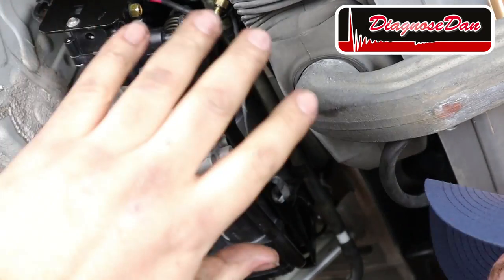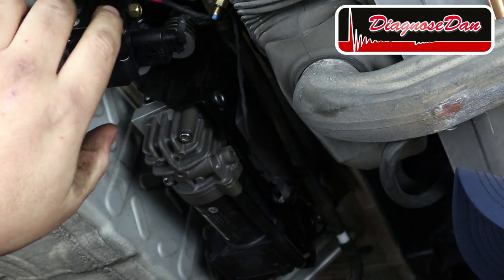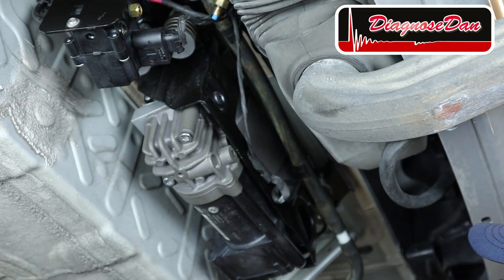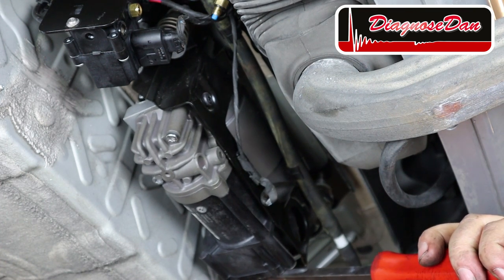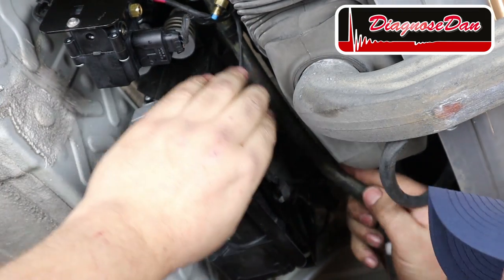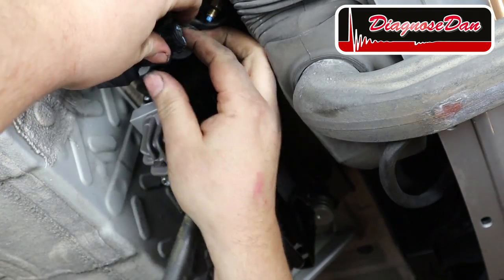This compressor is very easy to remove, but you have to remove the entire assembly. There are nuts on top, which you can't get to in the car. There are three connectors, two in front, and one at the back, an intake hose, and four bolts holding it down. Let's start out by removing the intake by prying it loose, like so. Get it out of its bracket. Then disconnect the connectors, one at the back and two at the front.